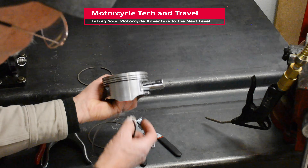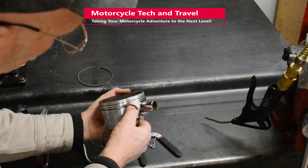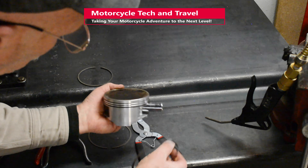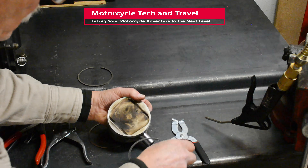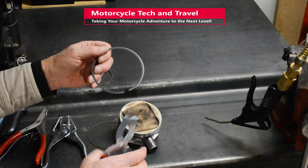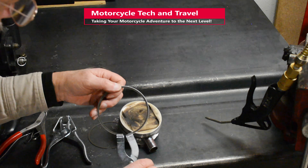It is easy to use a flat-faced or side-grip ring expander. When using an expander with wedge-shaped troughs, the ring ends can chip or the ring's face coating can be damaged at the ring ends. Many use these wedge trough expanders without an issue. It's a personal choice.